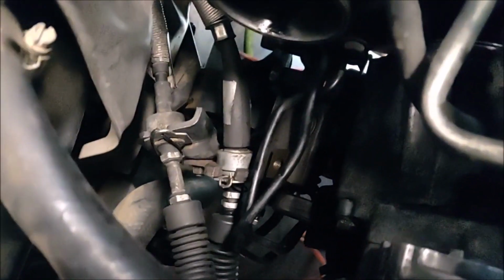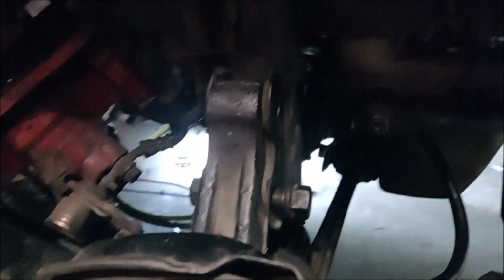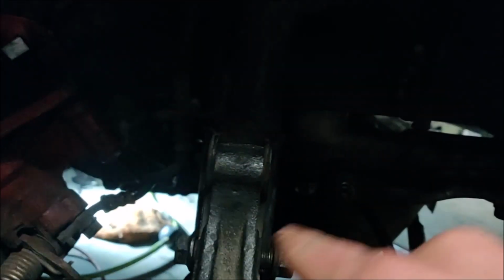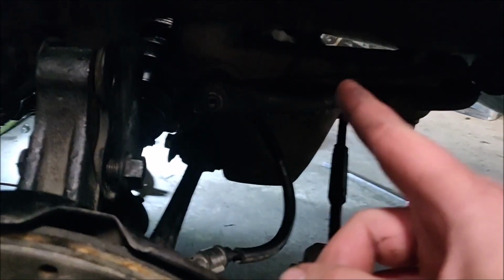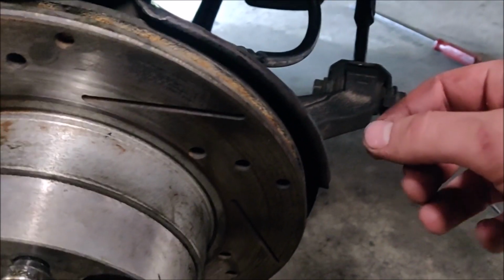We picked up some proper clips for the shifter cables. Well, another thing we noticed is on this ball joint, there is no nut. I didn't take that off, so that's missing. Probably from the last guy that did the work, who was missing other bolts and everything was loose. So, of course. We're also going to torque all the bolts around the CV axles, because those were hand tight when I took them off. I've got to pick up another bolt for the other side because one's missing. So I've got to go to the hardware store tomorrow, get some stuff, get a castle nut.